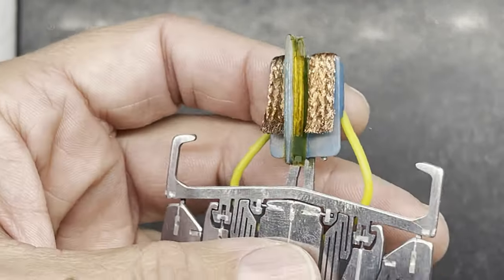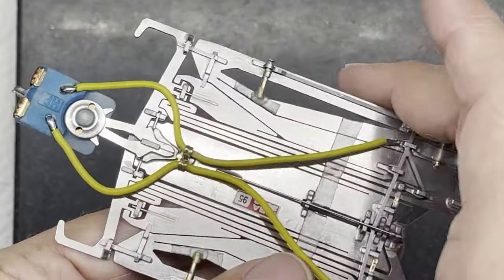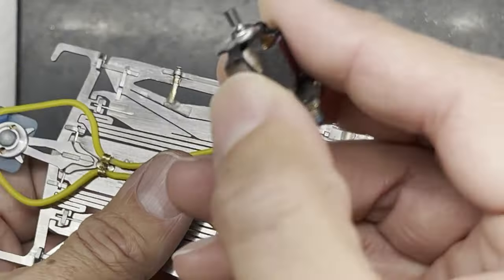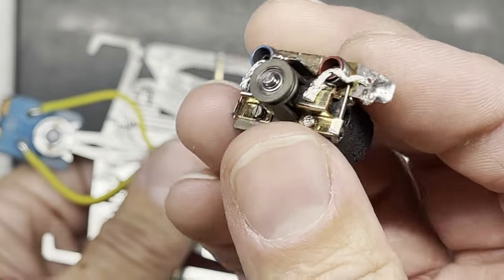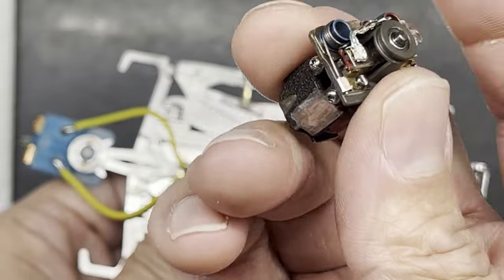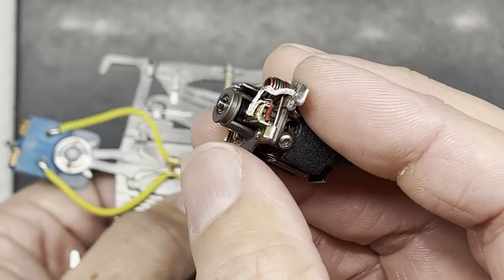I picked it up a bit. Still the car was slow. So I thought, oh, what's going on here? What's the problem? Now, I thought, oh, maybe the brushes are stuck in my motor. It was a similar feeling to the motor not getting proper power. Maybe the brushes were seized or maybe they weren't touching the comm right. A little bit intermittent sort of speed.